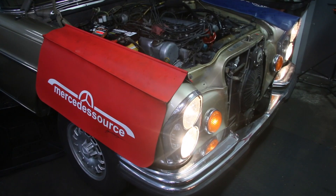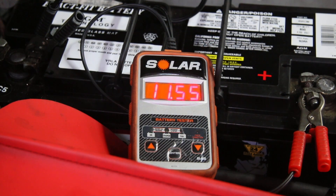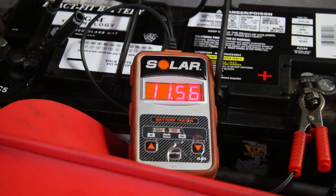It's 4 p.m. and this is kind of a surprise even for me. This battery had been dead for over three months. Two and a half hours with these headlights on high beam and they're still shining brightly — now they're just starting to fade. The battery voltage is at 11.55 volts. It's time to turn off the headlights and disconnect this AGM battery — I don't like to drain it below 11.5 volts. Tomorrow I'll put it on the fast charger, run it back up, probably do this one more time, and then retest the battery.